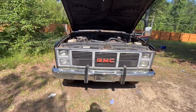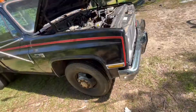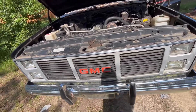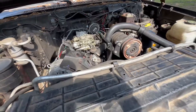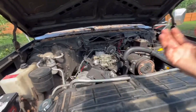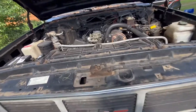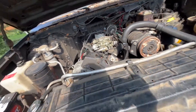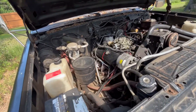Welcome back. In the previous video we did some work and I put an Edelbrock on there, but the thing was still not firing right. I tuned as best I could - I bottomed out all the fuel adjustment screws to where no fuel would get in, and the truck was still running too rich. So I slapped the quadrajet back on there just to see what would happen, and it's doing the same thing with that on there too. Something tells me it's something other than just the carburetor.